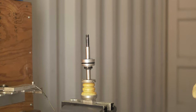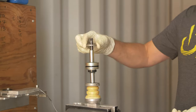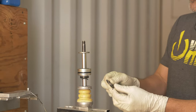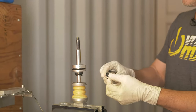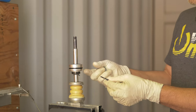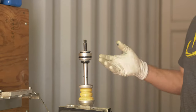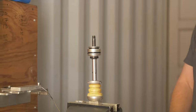On this particular bike, I'm going to go one step further and actually shorten the rear shock to lower the rear end of the bike. If I just put this normal plate on, the bike fully extends to this position when it tops out. I'm going to put a little plastic spacer in here — Racetech sells these. This one is three millimeters thick and will effectively lower the bike at the seat about 10 millimeters altogether. You can see now the shock doesn't extend quite as far. The nice thing is it's fully reversible — if you don't like it or sell the bike, you can take it off.